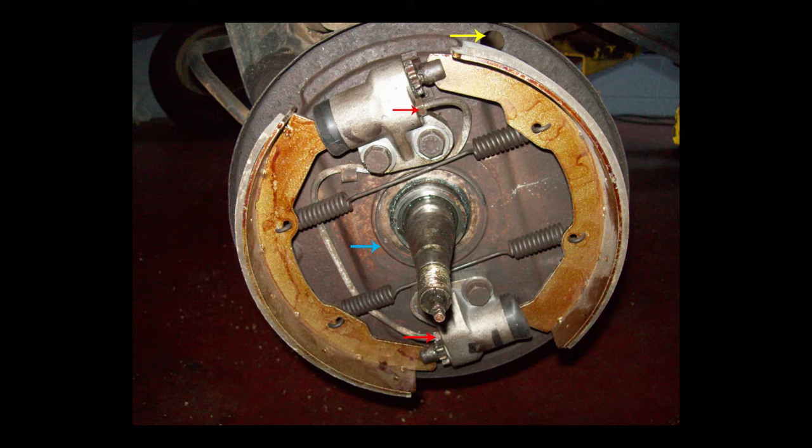The yellow arrow shows a brake inspection hole. I loosened the front brake line flex line from the top wheel cylinder shown here. Then I removed the wheel cylinders and just spun them off that flex line — that way I didn't have to loosen the other end of the flex line.